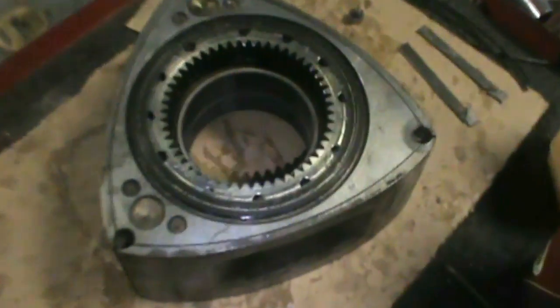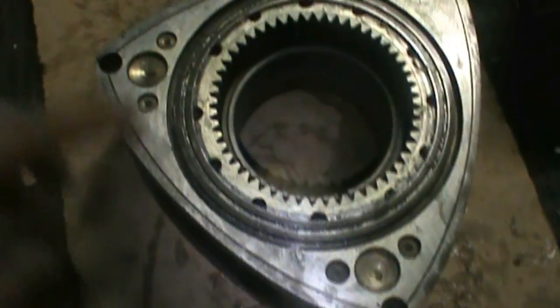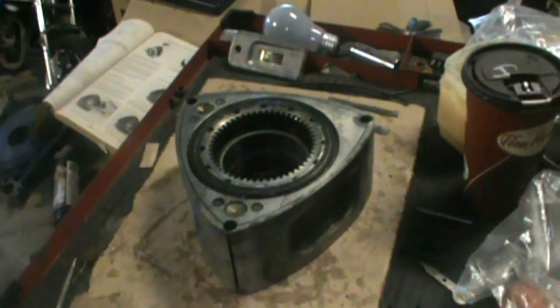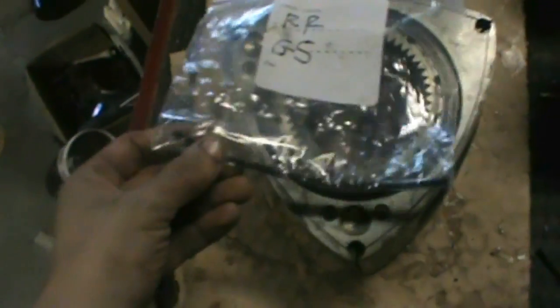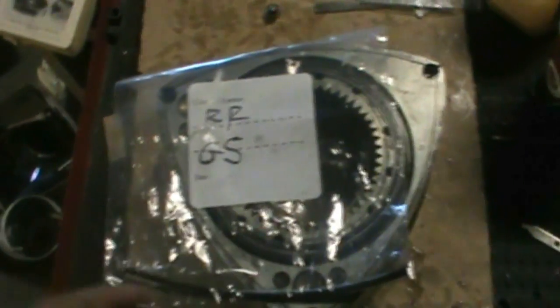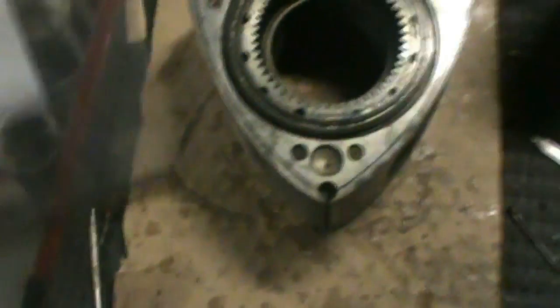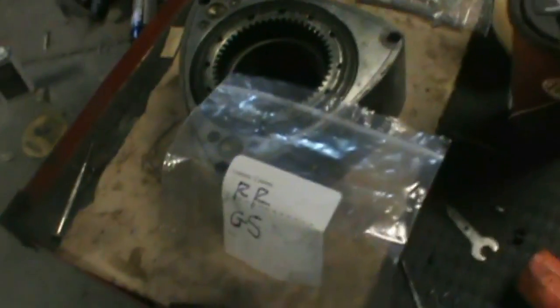Yeah, so I got the front rotor here. I'm just about to start clearancing the seal, so let's do it first without the Vaseline and just set everything in there real quick. Yeah, so I was lucky when I took my engine apart. I kept the side seals somewhat separated. This was my rear rotor before, but I'm going to be using it as my front now. But I have this rear rotor gear side, so I just have to shimmy those around to the different sides till I find which one they all fit into, so it's not too bad.